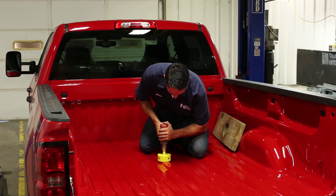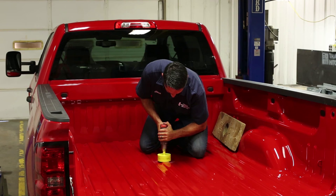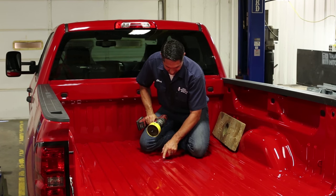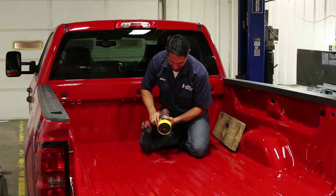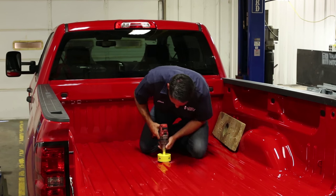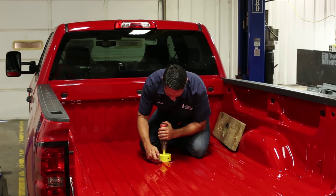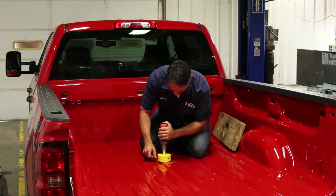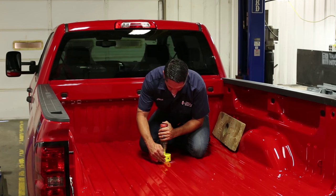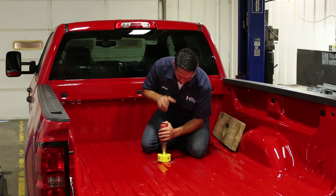Go reverse to establish your groove — just a little bit. You don't want to go a lot because it will begin to dull the teeth. Once you've got a nice groove established, switch the saw to the forward position and lightly begin the cut. The top of the bed corrugation is going to cut nice and easy. When you begin to transition through the upper and lower parts of the corrugation, the saw is going to try to grab — just let the saw do the work. Don't force it.